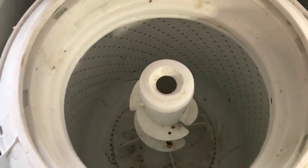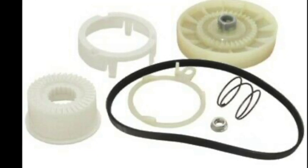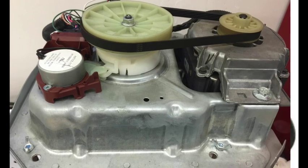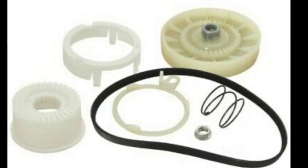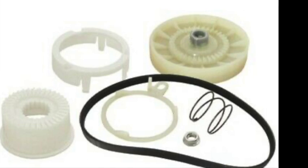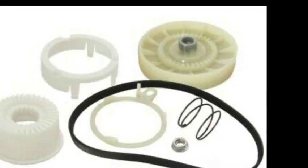What this tells me is that the splutch is probably not working correctly. Here's a picture of the components of a splutch. If you look under your machine, everything behind that large white wheel that the belt goes around and connects to the motor is the splutch. There's a spring and three components to it. The large one at the far left is the one that engages with the large white wheel to drive the drum. If these don't move smoothly together, they can hang up and both the agitator and the spin drum will move at the same time.